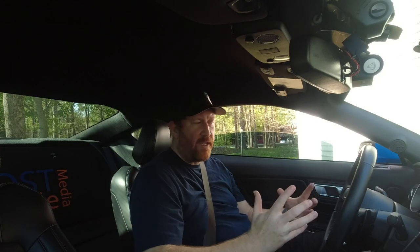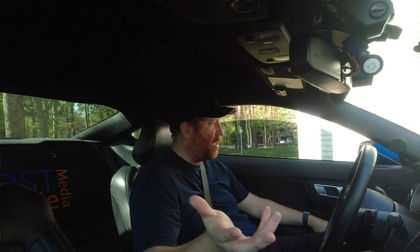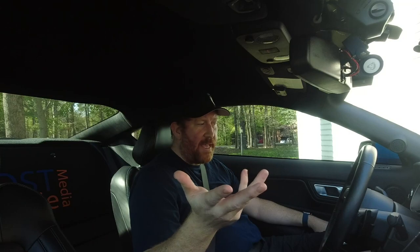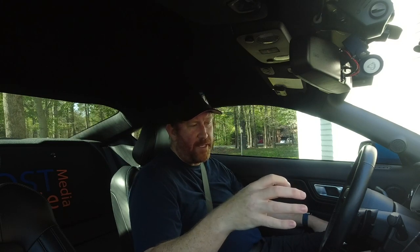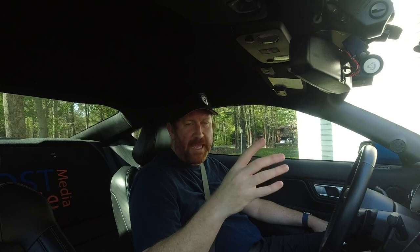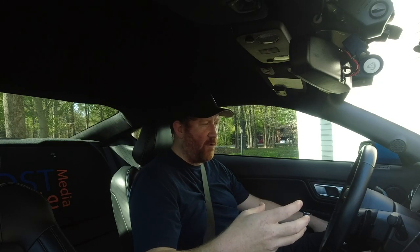A little drive in the car. You can see it drives pretty much stock-like, not a super big deal. I was not able to get the camera on the gauge that I mentioned, but I still see about 8.6, 8.7 pounds at like 7,500. So just keep in mind it's a little bit higher than their ratings from ESS if you decide to get one of these kits.